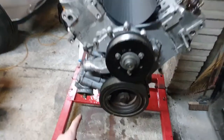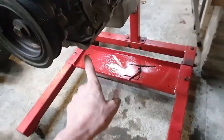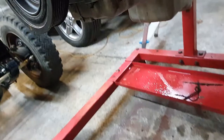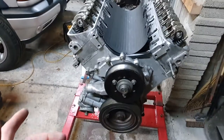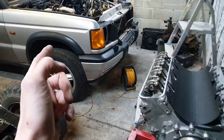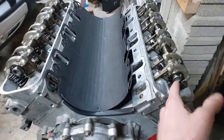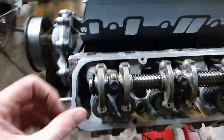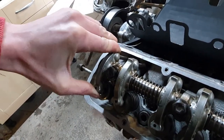What I'll do then is clean the oil radiator, which comes somewhere here and goes back in somewhere here — I can't find it, there is a return somewhere. Then I'm going to clean that out and actually I think I'll put some oil in and spin it on the starter motor, probably in the car, and see if I can get some oil pressure so that these hydraulic tappets actually harden up. Because at the moment they're full of air and you can move these against them.